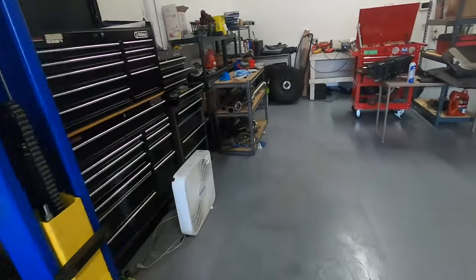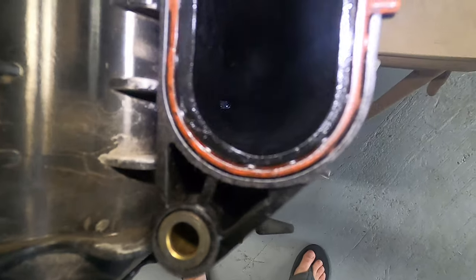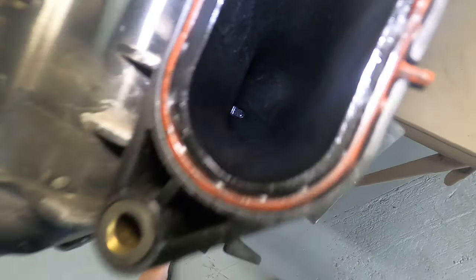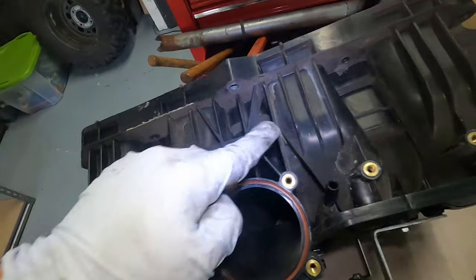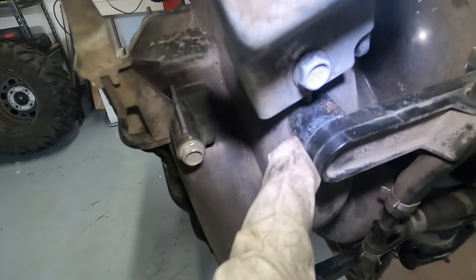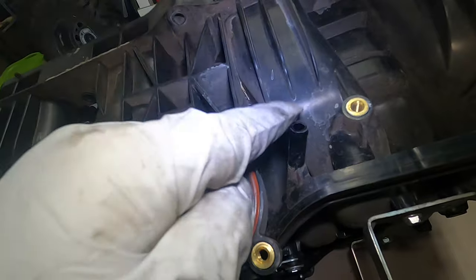I'm not going to run it like everybody else runs it. What you want to look for in here — if you look down in there, there's a little shiny piece, and what that is is a hole. For each intake runner, they all have this kind of bulkhead fitting or manifold fitting. You can see one here, one here, one here, and one here, and there's this big long track that connects them all, and they all go to this PCV line.